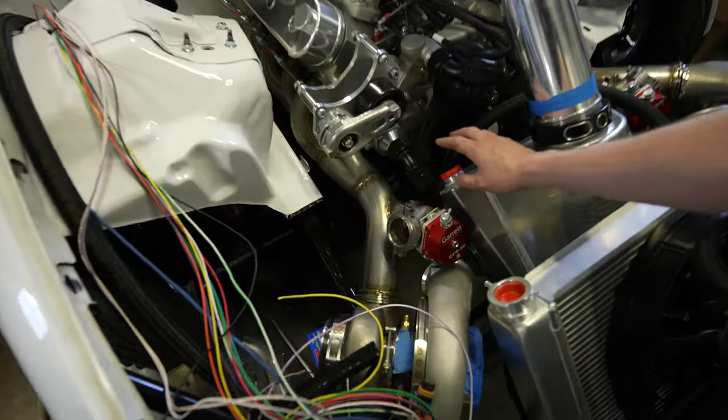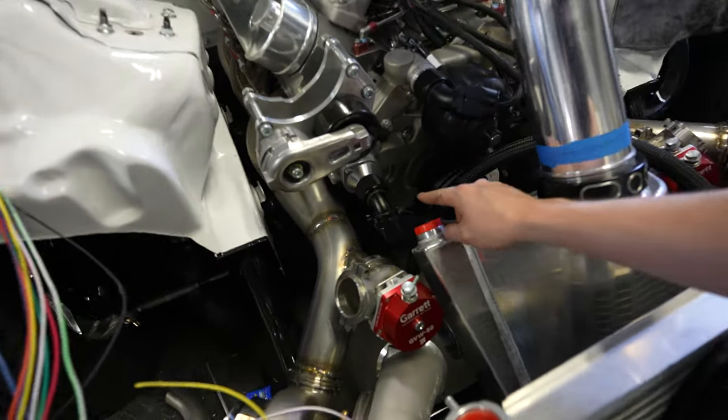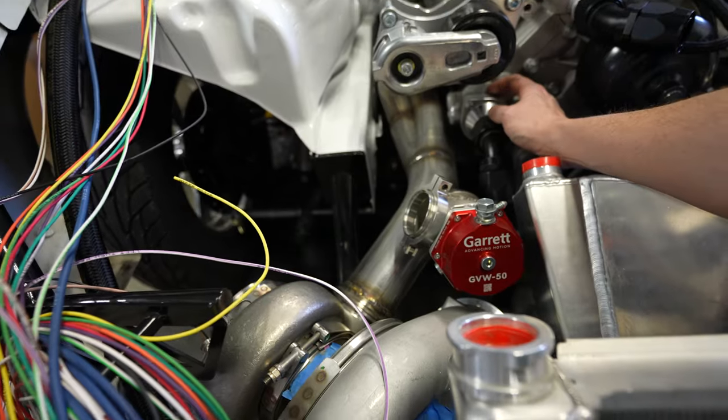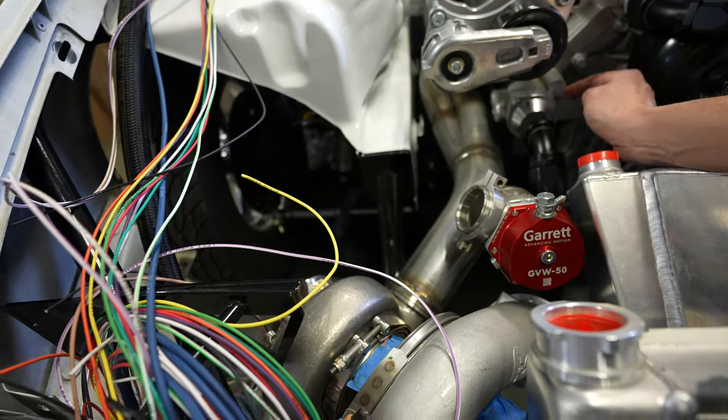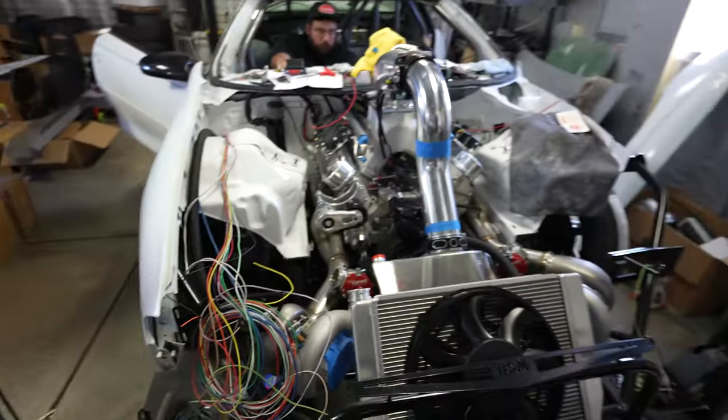The fan is really designed to be on the inside with a guard on the other side, but I don't have the room here. You can't flip it around and reverse the polarity, but it can still become a pusher by moving it to the outside, so I might come up with some little cover guard. One of the last things we've done is modified the water pump — put big 20AN fittings using an Earl's adapter that makes it into a typical thermostat housing and puts that on 20AN lines. Still got a couple more fittings coming for that.